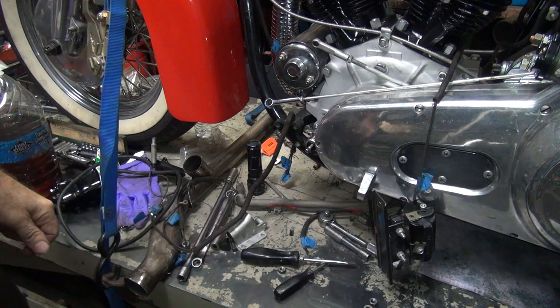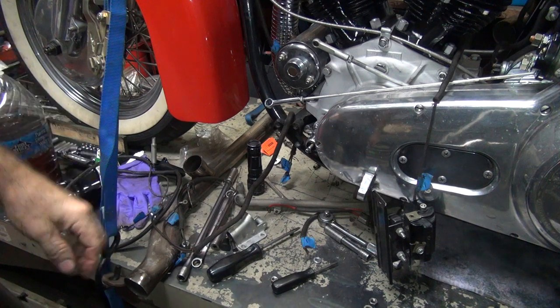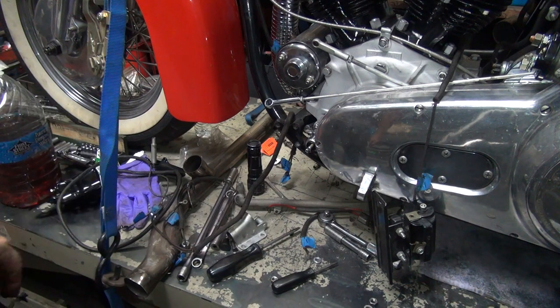The post here flat would probably be best, but this one's getting pretty tight so I'm going to leave it. I can see it's still trying to go down and short out. Take a screwdriver, stick it between the post — that keeps it apart. Ideally you want to put a loop in the wiring like that, get a little bit of jiggle room so it'll vibrate and not be too big of a deal. Okay, that part is in there. That was a pain in the butt to do — what a shocker.